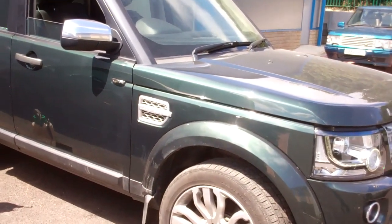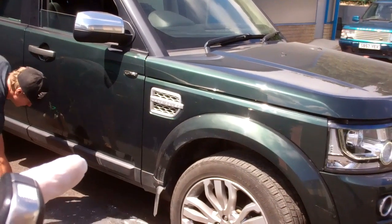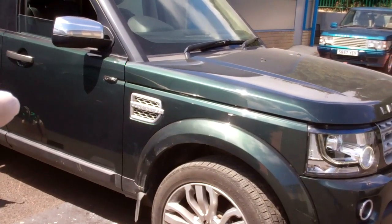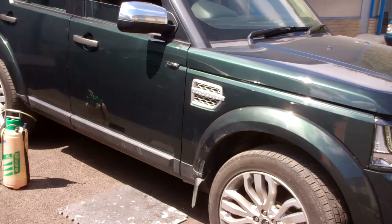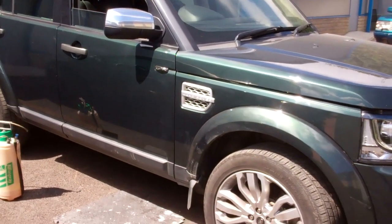So for the final filling, we filled it up through the sump plug till it reached the level. We've now got it outside. We then started it and put a bit more in. We've now got the final fill. We've got it outside because you've got to have the engine running, so don't run it in the workshop or you'll be killing yourselves with carbon monoxide.